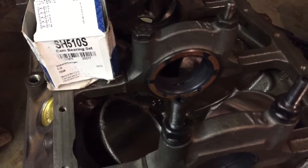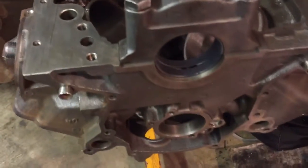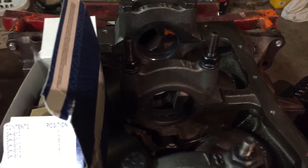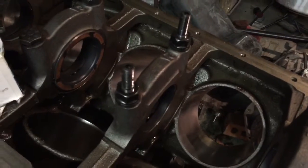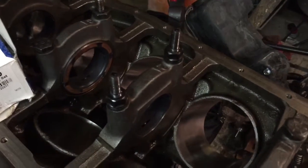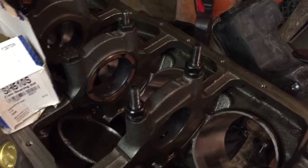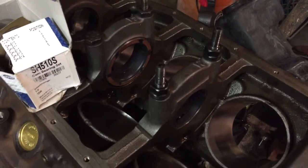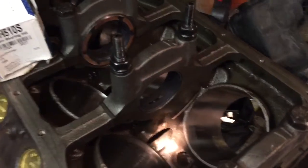You can see there's the thrust washer on the central bearing surface, and all the bearings are installed. The mains are torqued at least temporarily while we wait for crank installation. I'm not going to do that until I fully clean the block — anytime these blocks come from the machine shop they're coated to prevent surface rust, and I don't want to wash that coating off until I'm ready to progress with the install. One exception: I am installing the cam gear and cam bearings into the block.